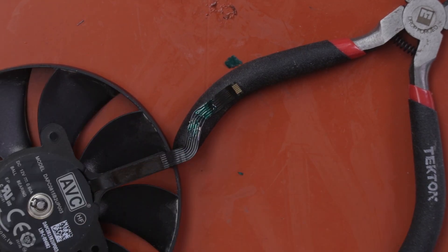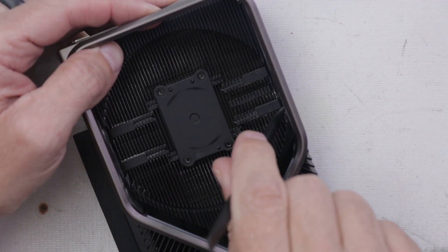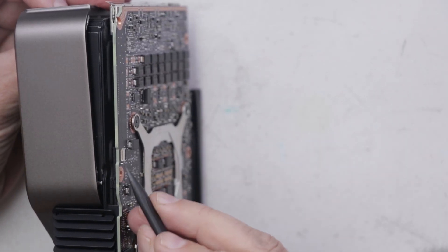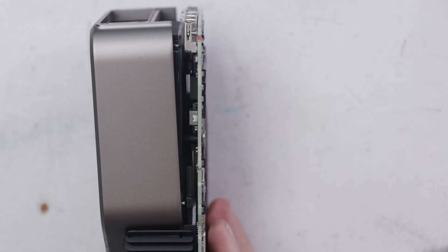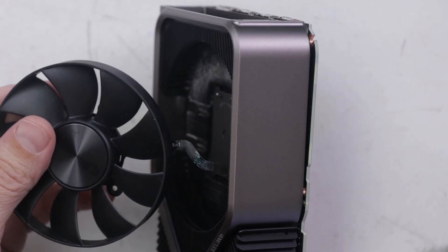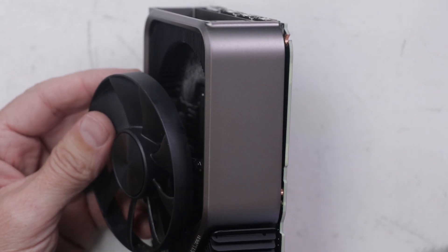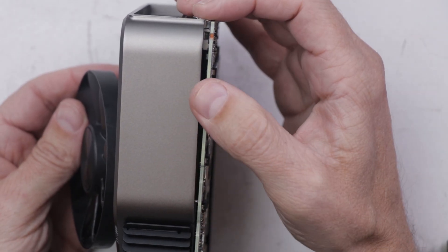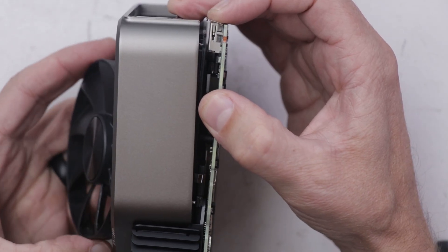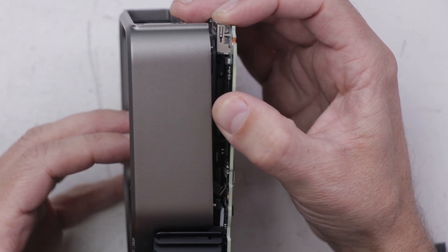So I'll do that and then we'll install the fan onto the graphics card. The fan needs to mount down here and the ribbon cable for the fan needs to go right up here in this little gap, then comes out right here through this little channel on the board and plugs in right here. So I need to do this without messing it up. The cable caught on something — hopefully not too big of a deal. There we go, got it coming out. The fan is mostly where it needs to be, I've just got to get that cable up.